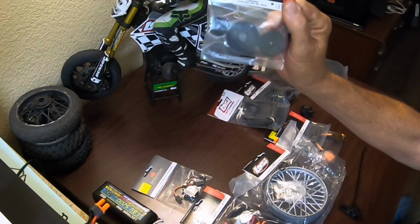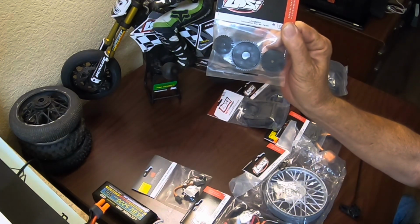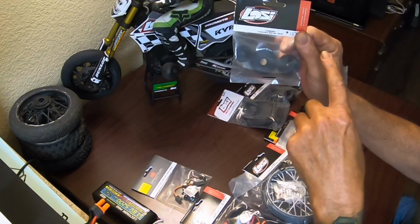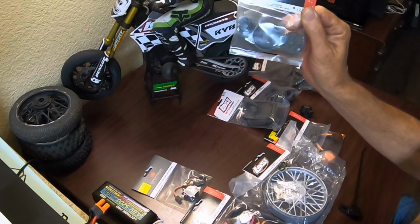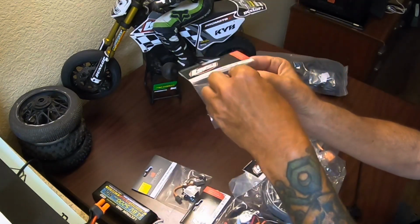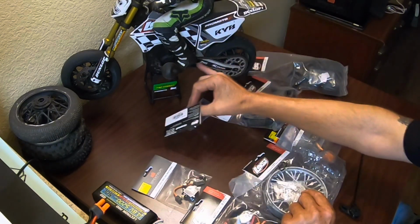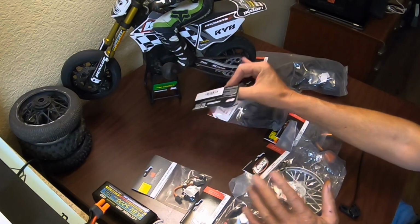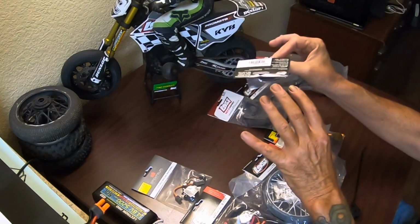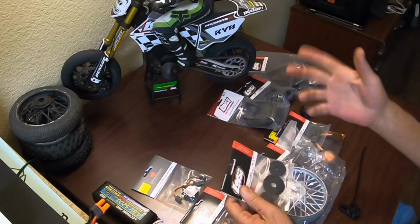Here's the 3 gear set that's on the side of that, because I figured it would eventually strip out. There's 4 gears in there. There's these 3 gears, and then there's the pinion. So 3 gear set plus the factory pinion is 4 gears just on the one side. Then you have the front sprocket and the rear sprocket. So 6 gears. This thing is geared 6 different ways before it drives that tire. So that's why I'm doing all this experimenting.